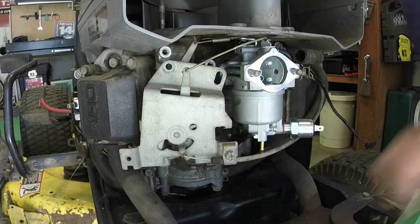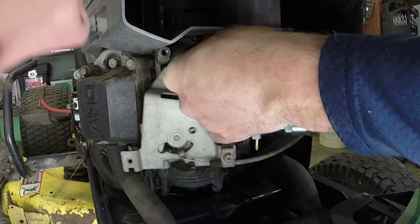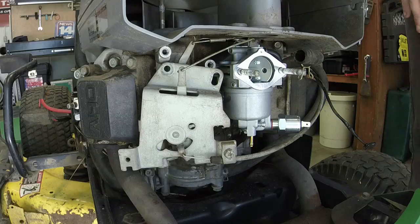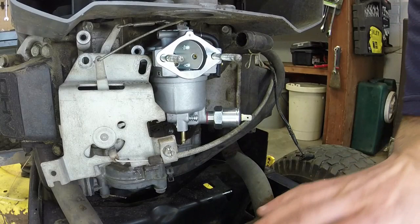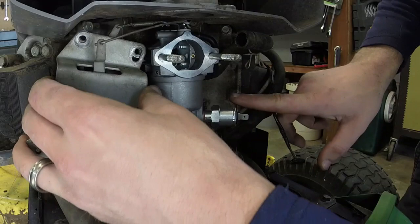And I probably got to get where the camera is. Let's see. I just got to get that spring on, and then I'll just be able to push everything back. I'll bolt that back on, and then I will catch y'all. I'll show the fuel pump on camera, too. All right, so a little bit of, excuse me, needle-nose pliers got it on. Just popped it right in the throttle hole there. So now we're clear to put everything back on like it needs to be.